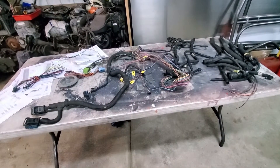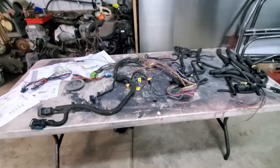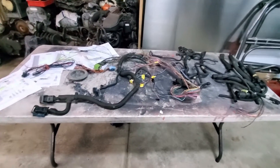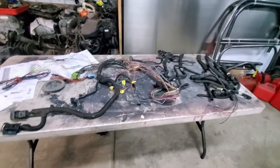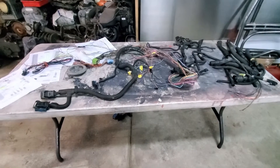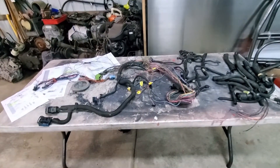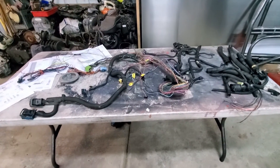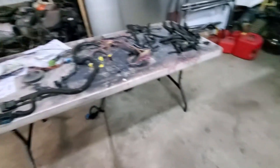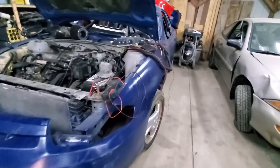I'll probably just run wires out for all of your gauge outputs, or I could sell it with gauges — I don't know. I'm going to run the stock fuel pump wiring all the way to the back so all you have to do is just plug it in at the trunk pan. I'll even put a relay in the harness so I don't have to explain to people how to wire this stuff up. It should be a pretty simple harness, universal to whatever car you want to run. I think that's the way we're going to go. I'm about to tie up the one in this blue car.